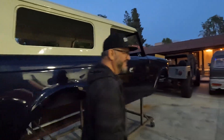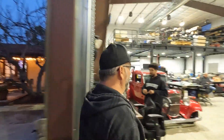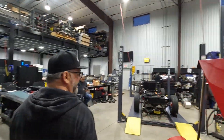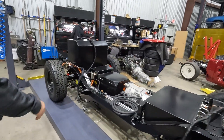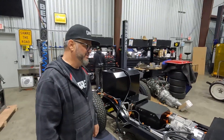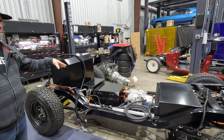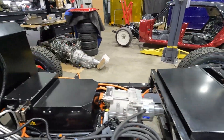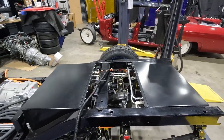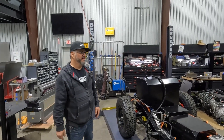Let's look at the chassis — this is where it's all going. The chassis is two-wheel drive, since it's the mail truck version. Most Scouts are four-wheel drive, but this one has a straight I-beam front axle. We did a small lift kit on it, powder coated the chassis, and made a bunch of adjustments including the engine mount. It has four battery boxes — one, two, three, four — and they're not taking up any space on the inside of the vehicle, only underneath and under the hood.